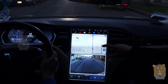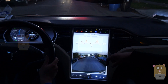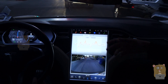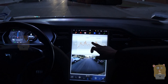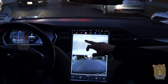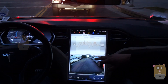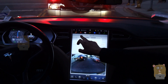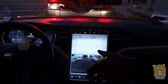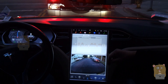Can you navigate to the energy consumption? Right here — projected 154-mile range, but rated we're at 192 according to the dash. That's based on average range; instant range is a little different. It gives you a chart based on your 5-mile average, 15-mile average, and 30-mile average — different rated range for each increment. On the 5-mile average, which is really the time you've been driving, it's 172, on a 192 rated.